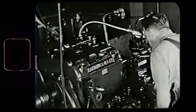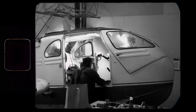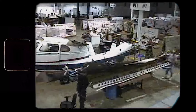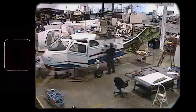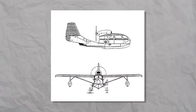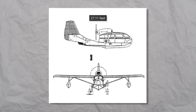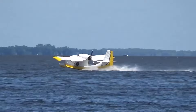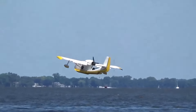One of the things that allowed Republic to produce so many Seabees was clever assembly management and bare-bones simple construction — simple to the point that the wings have no structural ribs. The fuselage is built from strengthened aluminum and provides enough strength for safe flight. In terms of size, it has a length of 27.11 feet with a wingspan of 37.8 feet. Its empty weight is just under 2,000 pounds, and it can carry around another 1,000.